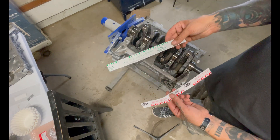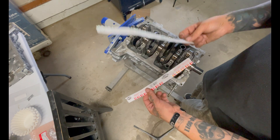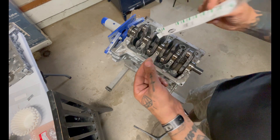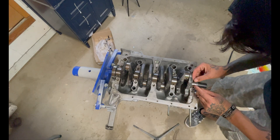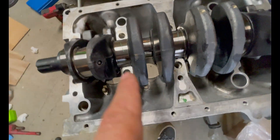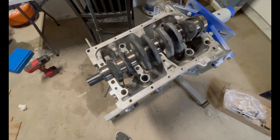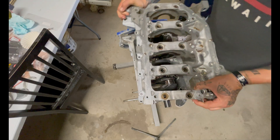There's red and then there's green plastigauge. Since you're working with Honda it's in inches, so you want the green one — you can get these at Amazon, O'Reilly's, wherever. You take the plastigauge out — this is what you're going to be compressing — and this is your clearance reference. I pre-cut five pieces. This is where it gets kind of tricky. You'll see them on each individual journal, then we put the girdle on, do our torques, take the girdle back off, and then measure your plastigauge. Be super careful.